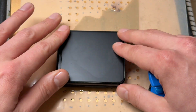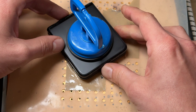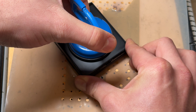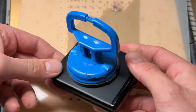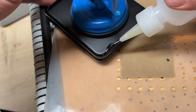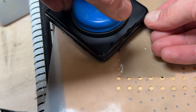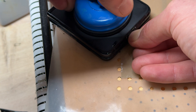After it's spent five minutes warming up on here, this thing is the perfect size to fit our suction cup onto. So we clip that on there, and then I'm just going to lift upwards very gently, and hopefully we'll find that it will come away from the back cover. Don't be tempted to pick up the wrong side — obviously the charging port is in the bottom half of the phone. If it doesn't lift up so easy, just use a little bit of isopropyl alcohol all around that edge, and that should soften it up enough for you to begin lifting and separating that back cover.